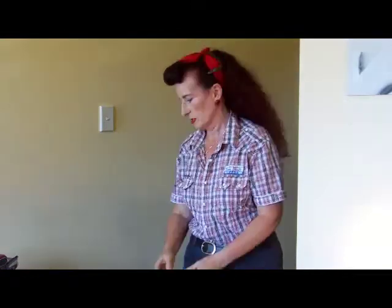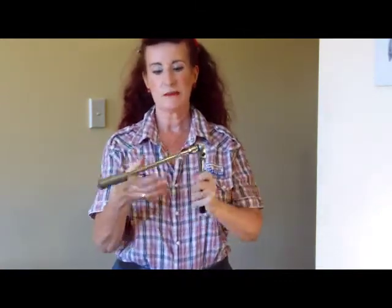I find they actually work better even when I race - I had iridiums in but it didn't seem to run as good. Today we'll also use a spark plug gapper to check the electrode on the end of the spark plug. You have to make sure it's not too wide or too narrow, otherwise the spark won't jump far enough. This is actually a vintage spark plug gapper. We'll also use a spark plug socket, a ratchet, and an extension to get in past my extractors.